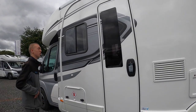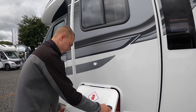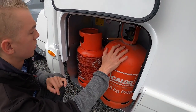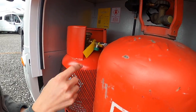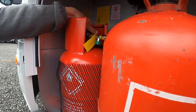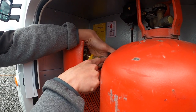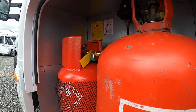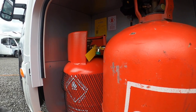Coming further down you do have your LPG — liquid petroleum gas. In here you can get a 6 and a 13 kilogram gas bottle on board. To use it, put the gas on the pigtail — it's a left hand thread — and then tighten it up with an adjustable spanner and turn on at the top of the bottle. Once you've turned on at the top of the bottle, press this green button here — it allows the gas through the crash valve and into the van, and then your gas is ready to use. When travelling, always make sure it's turned off and make sure the bottles are strapped in with the straps provided, so the gas doesn't roll around when you're travelling and it's secure should you be in an accident.